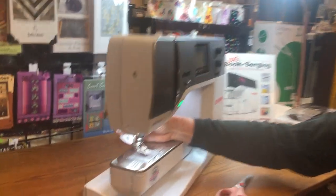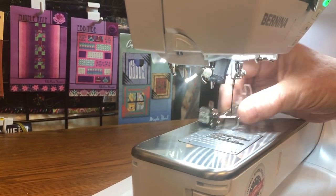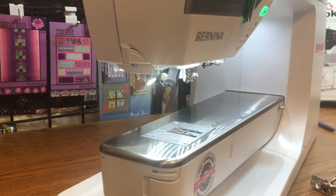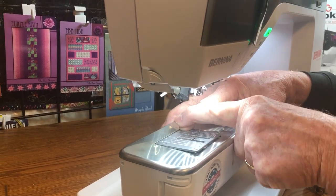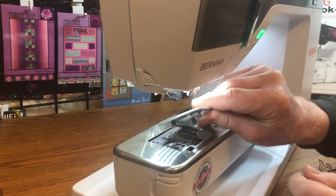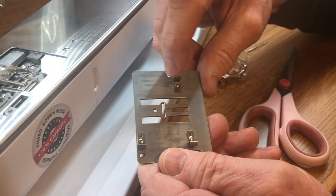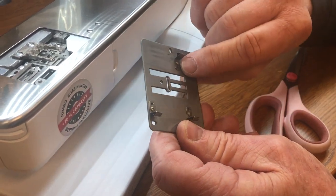Now let's remove the presser foot. I have the dual feed engaged so I'm going to pull it down into the back — there's the dual feed. I'm going to take the foot off and remove the needle. A lot of manuals say turn off the machine at this point — that's the lawyers talking. I'm going to leave the light on for filming. Push down using two fingers on the little circles, lift up, and pull forward. If you push to the back it will get stuck and you'll be wiggling it for 10 minutes. Make sure the back side of the needle plate has all three clips — I sell those for $2.99. A lot of people break them off; if they get bent and you try to bend them back, they break.